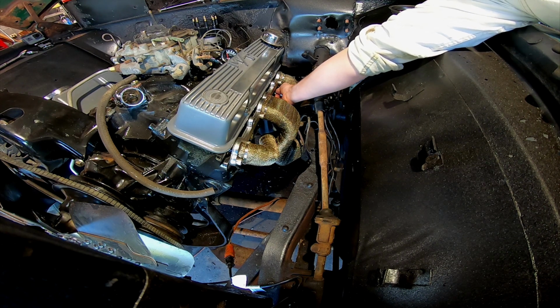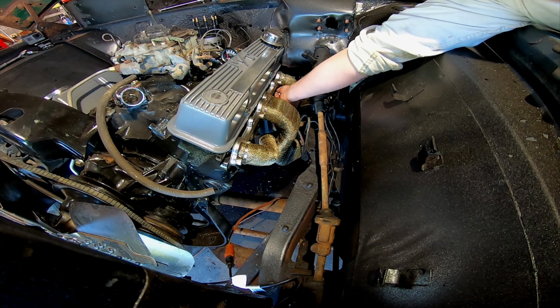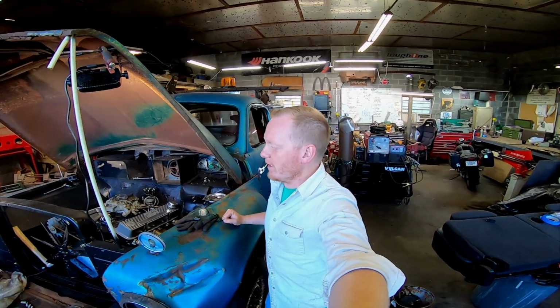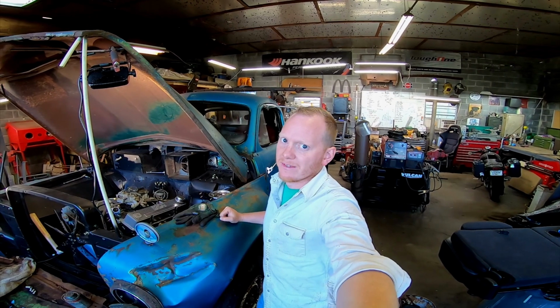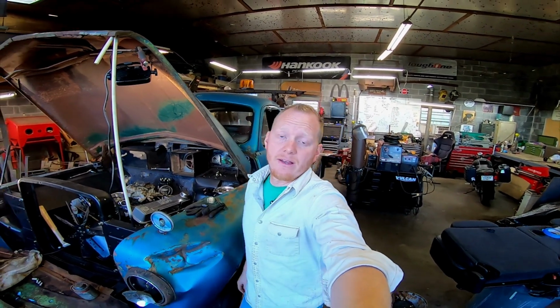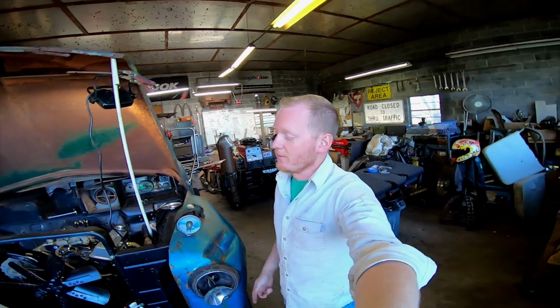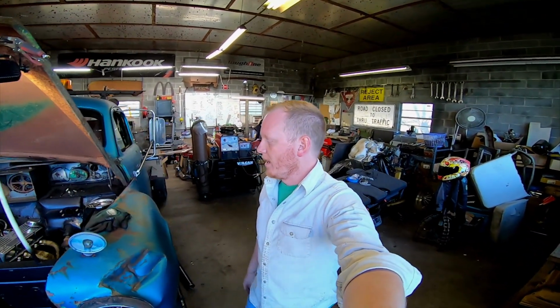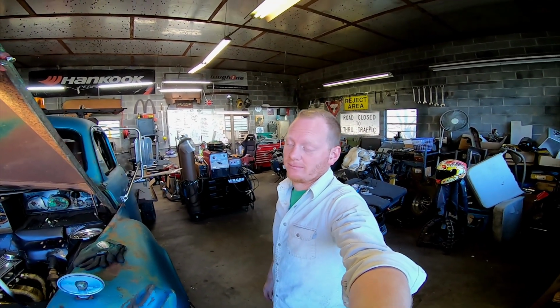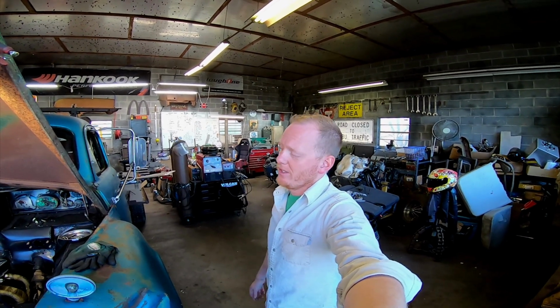Well, these are probably the wrong plugs. It's a really good thing that I have Amazon Prime, because nothing on this vehicle fits. The spark plugs don't fit. They're gasket seat, and I need tapered seat plugs, so they're not even going to come close. So yeah, they're getting sent back. I've got the right ones on the way this time. So I guess we can go ahead and throw it in the air and throw the exhaust in it, which probably won't fit, even though I made it.